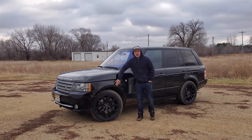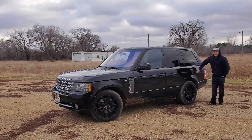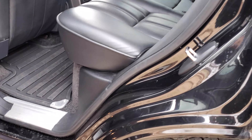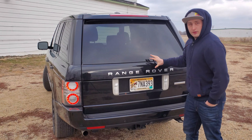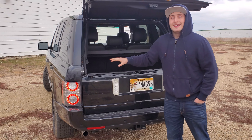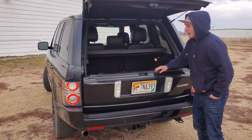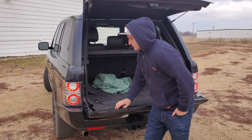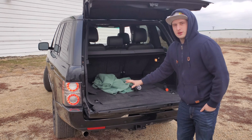This fender right here is aluminum — it's not going to rust. The doors are aluminum as well. The roof here is steel, and this section is steel as well. If you open up your doors, it's very possible that there's going to be some rust on the inner parts of the doors, so be sure to watch out for that. Moving around to the back: the top piece of the trunk is aluminum, but the tailgate is steel, so you're going to see rust down in these corners. When you open that up, a very common spot for rust is right in these tight little crevices. Also be sure that the tailgate opens and closes just fine, as there can be some corrosion. Those are the spots to watch out for rust.